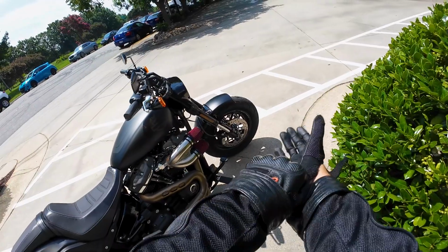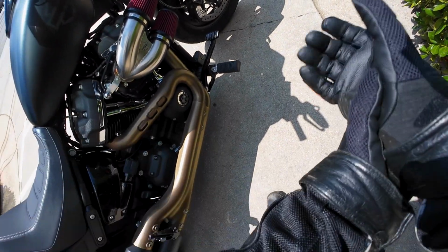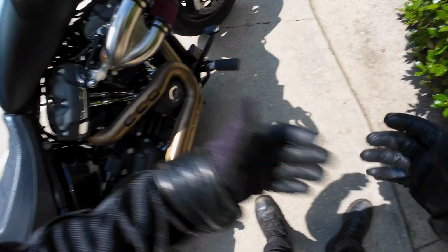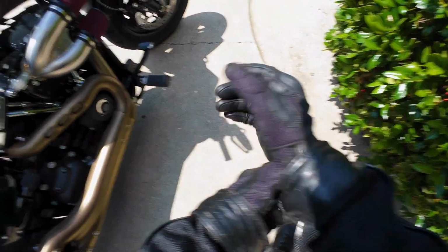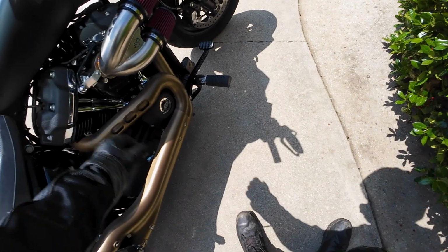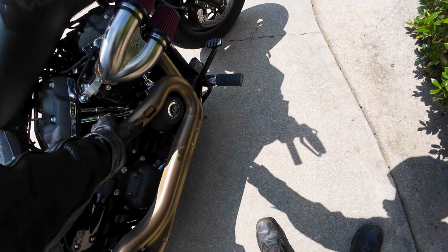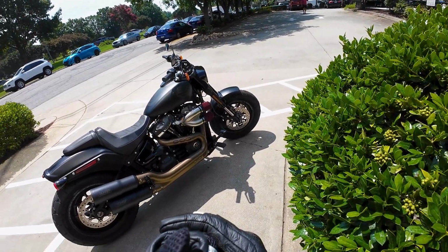One easy way to tell sometimes if there's a cam is whether or not it has adjustable push rods. The easy way to tell that is where the collars are. If they're a little bit higher up, then it's probably your stock push rods or just standard push rods, which you'll typically see with bigger motor work. But if you don't have to take the heads off like you would on a cam job, a lot of times it's just little adjustable push rods, something you can just squeeze in there. Usually those will go in. An easy way to tell that is the collars are usually a little bit more about midway. So I wouldn't be surprised if it did have a cam in it.